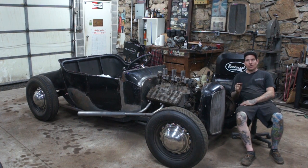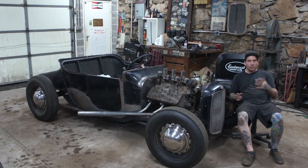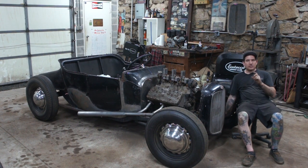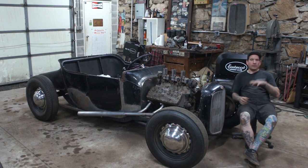I just took some 5/8 steel, heated it and bent it like you saw in shots earlier. And then I welded it to the frame where the radiator would have mounted. And then I just relocated the holes on the bottom. It mounts on the radiator like it would have originally. And I can make some rods here to go from the radiator to the cowl, and it should be really sturdy and strong. I think I'm going to try and figure out a way to run the original springs or a spring type setup for the bolt at the bottom, just so we can avoid any cracking or damage to the radiator from everything flexing around. You really do need those bolts with the springs on them like they had originally. It helps the grill flow around with the car and the frame when you're going over uneven ground and things like that.